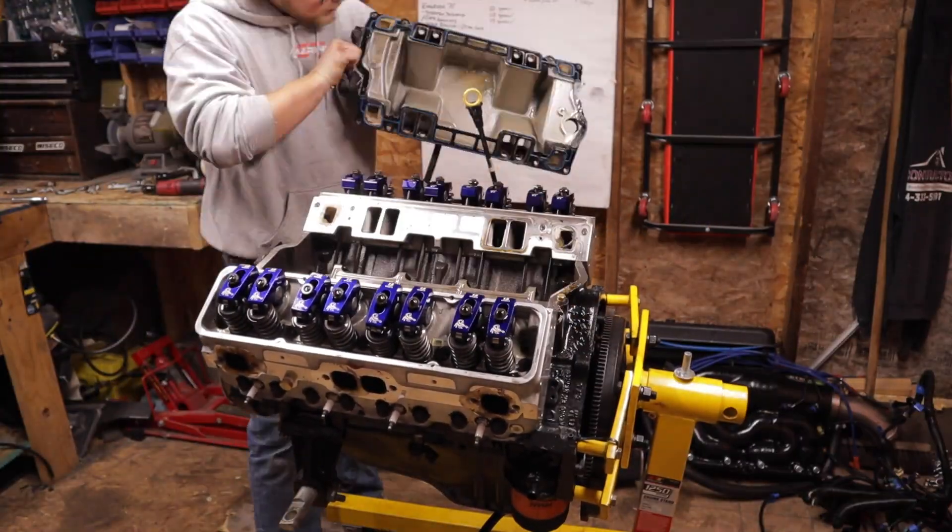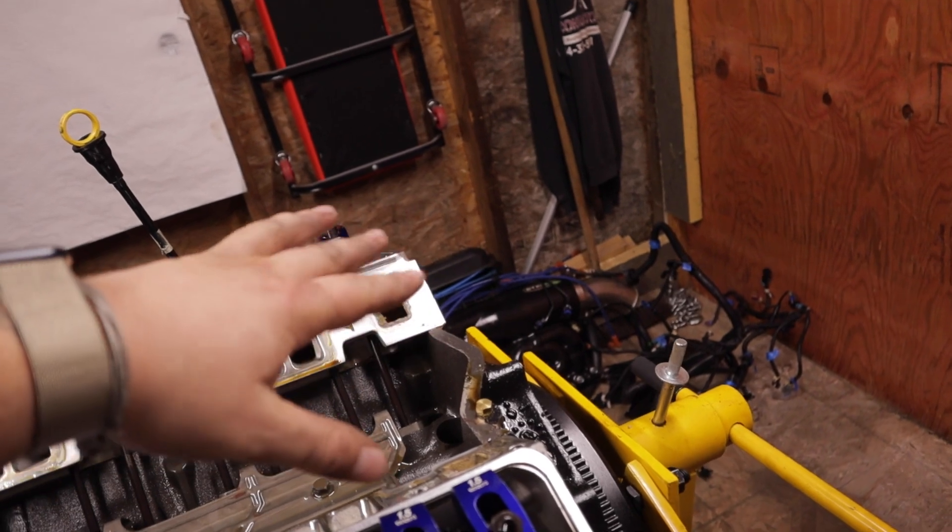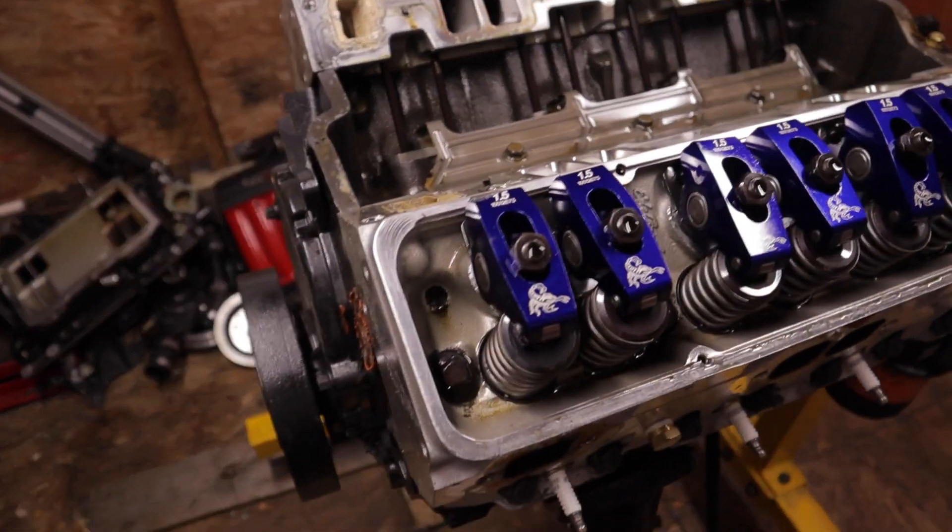We've made some serious progress today for the little bit of time I was here. I have to finish up because I want the next video to be the actual diagnosis. To recap: it was mostly time-lapses but I took off all the wiring on the whole motor and the whole FEAD system — which was really the alternator, alternator bracket, thermostat housing, water circulation pump housing, and the actual impeller housing — as well as distributor cap, rotor, and the bracket in the back.